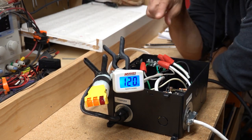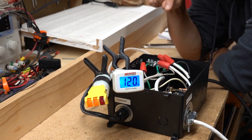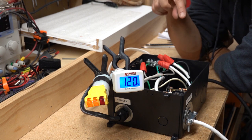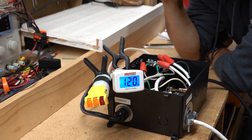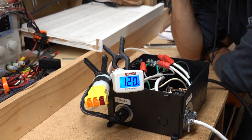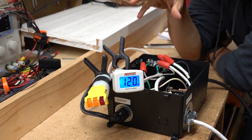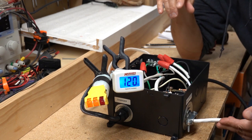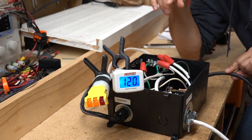The charger fires up right away. The switch is on a 20-to-40-second delay, so it's going to take a few seconds to switch. We should hear a clunk — and there it is. Now it's powering the system from the shore power cable and not the inverter.